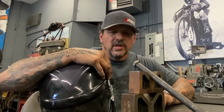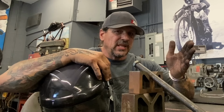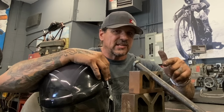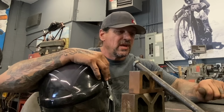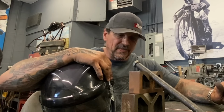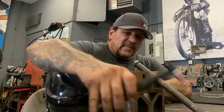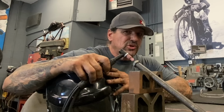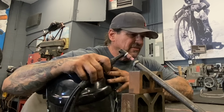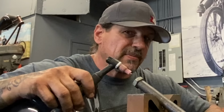Here's what I'm going to do. Weld the end of the axle. I cut a nice groove in there in the lathe, both in the end of the axle and the nuts. I've got a real nice deep V to get really good deep penetration for good holding power for this axle, because I don't want the nut to spin off. I don't want the axle to be able to break out and push its way through one side of the bike and lose my rear axle. So I've got a deep V cut there. I'm going to come in with the TIG torch, and with the torch I'm going to cut a real deep puddle first and really get it cooked together, just fusion welding. Then as that fusion weld solidifies, I'm going to come back over with the TIG rod and fill it and add more material to it so I have more strength.